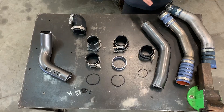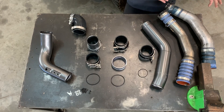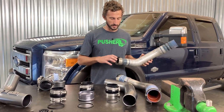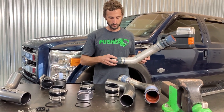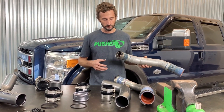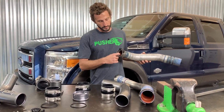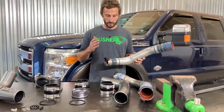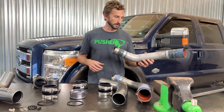This is listed on our site — it can be bought separately or in a kit. The hot side has similar issues, not as common as the plastic charge tubes. Again, these are full assemblies you can only buy the whole assembly. The factory charge tube uses a C-clip style connection — a C-clip slips over and falls in a groove that holds this connection to the outlet of your turbo, and it uses a wiper style, thin O-ring. So if you ever have an issue anywhere — blow a coupler, have a problem with that O-ring — again, whole assembly. This is about $100 list.